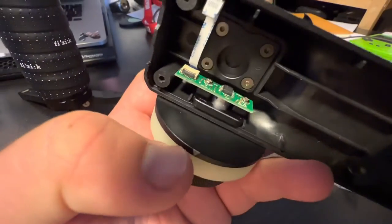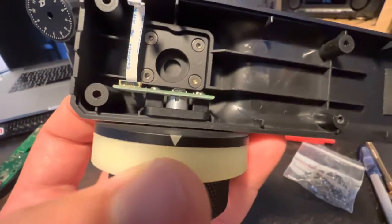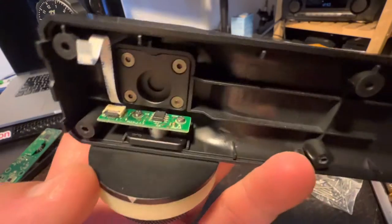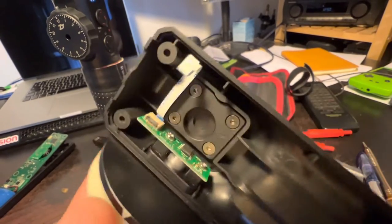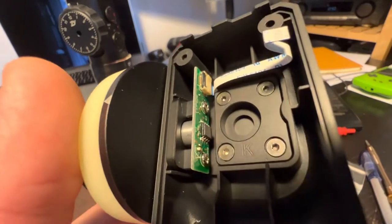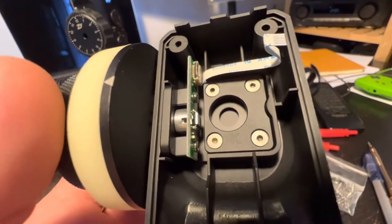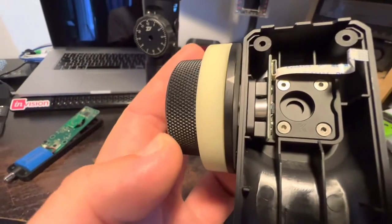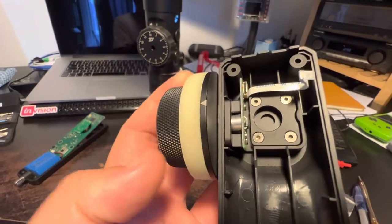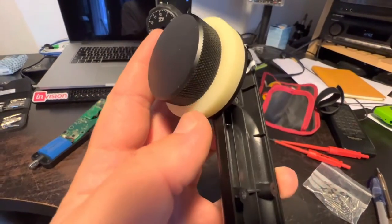It's actually a really nice mechanism. There's a neodymium magnet in the spinning part, and a small chip that acts as a receiver — it reads the position of the magnetic pole and translates that into a focus position for the sensor. It's a pretty smart mechanism, very nice.